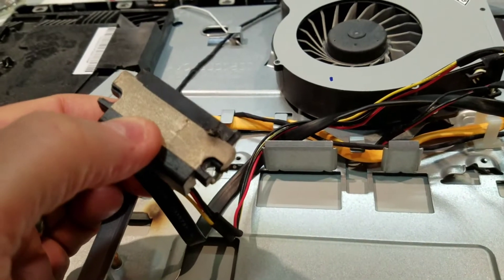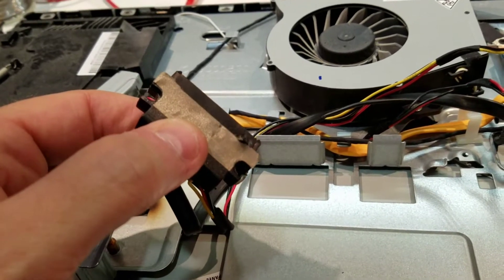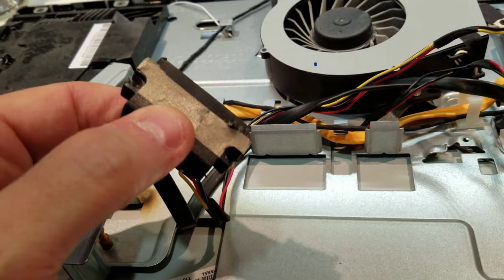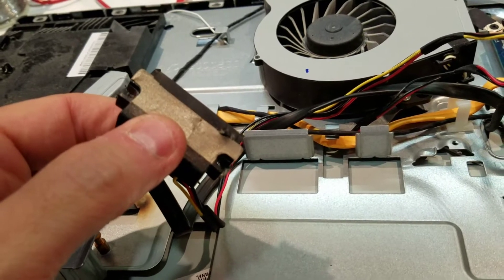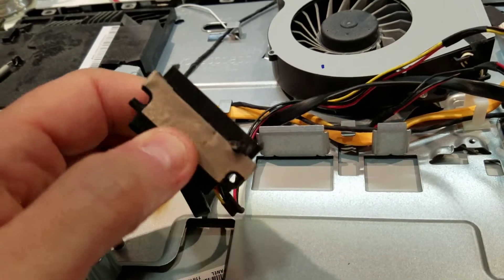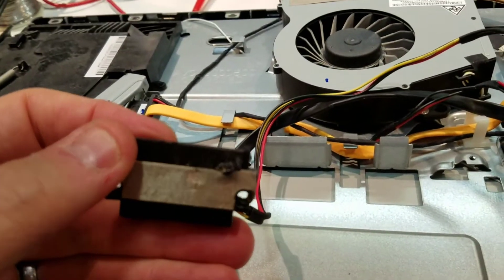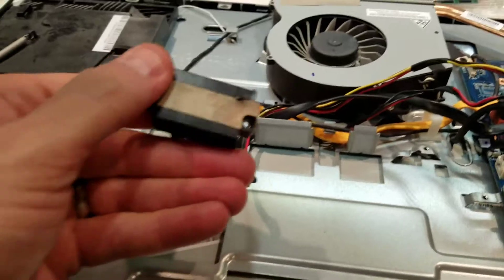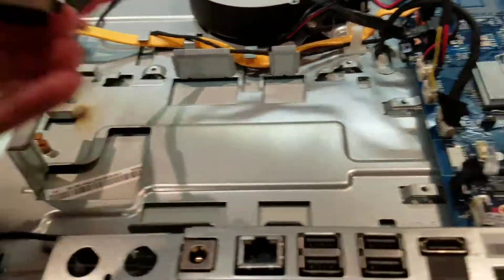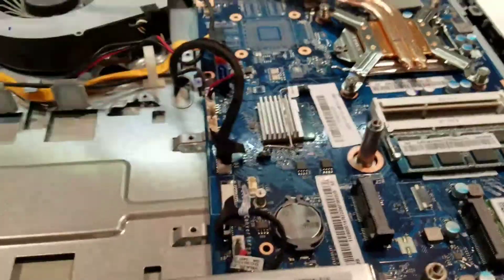If you look at the bottom side of the connector, that thing is toasted and burning through — you can see it right there. There's something wrong with the way this connector is manufactured — I think it's a poor choice of materials causing corrosion between the two metals that make the contact surface. It takes a year or two before that corrosion builds up to the point where the connector rots out, shorts out, and takes the machine with it. Fortunately it doesn't seem to damage the motherboard — just gives the click of death.